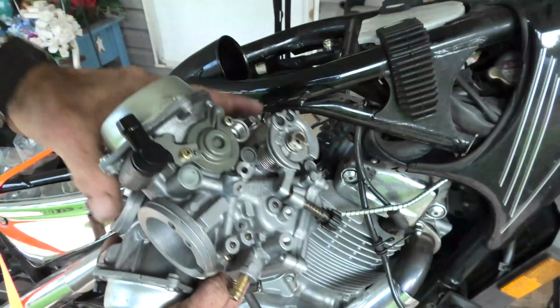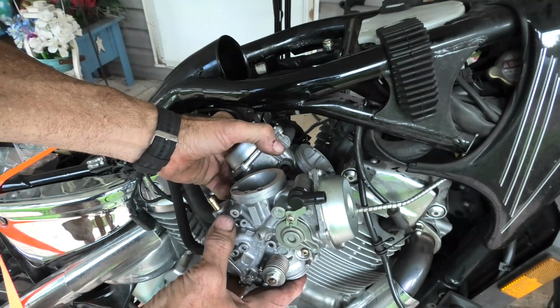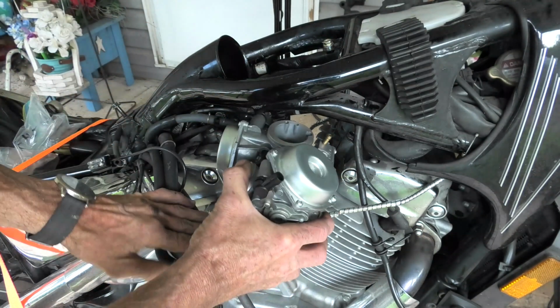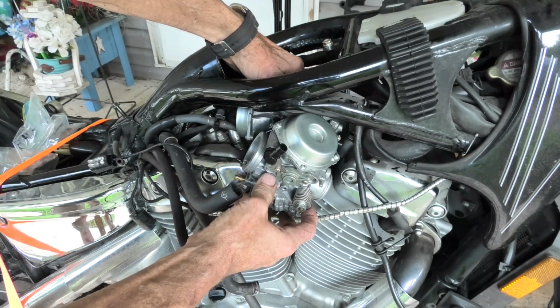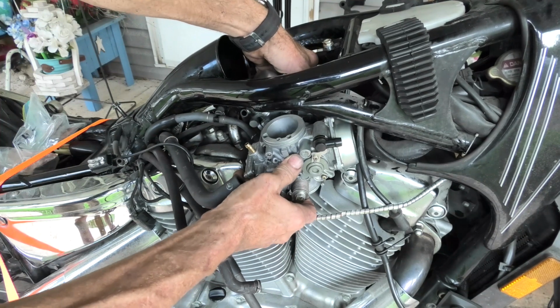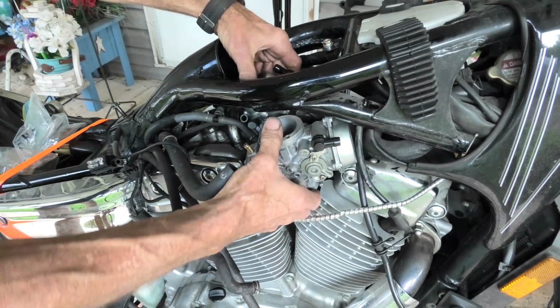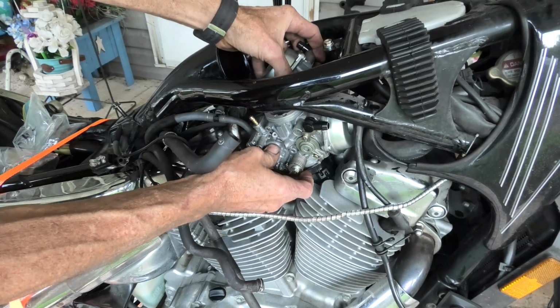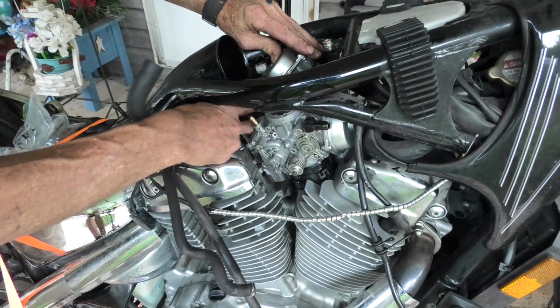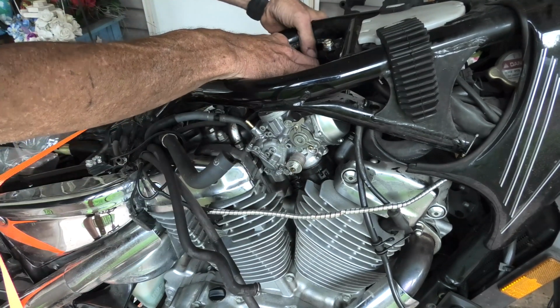And there are the carburetors freshly rebuilt and cleaned, as earlier videos covered the whole procedure. And we're going to take them and you've got to go in on an angle if you watch, and then give it about a quarter of a turn and wiggle and jiggle. And eventually, it actually went in a lot easier than it came out. Again, some of those insulators stuck when I took it out, which made clearance a problem.